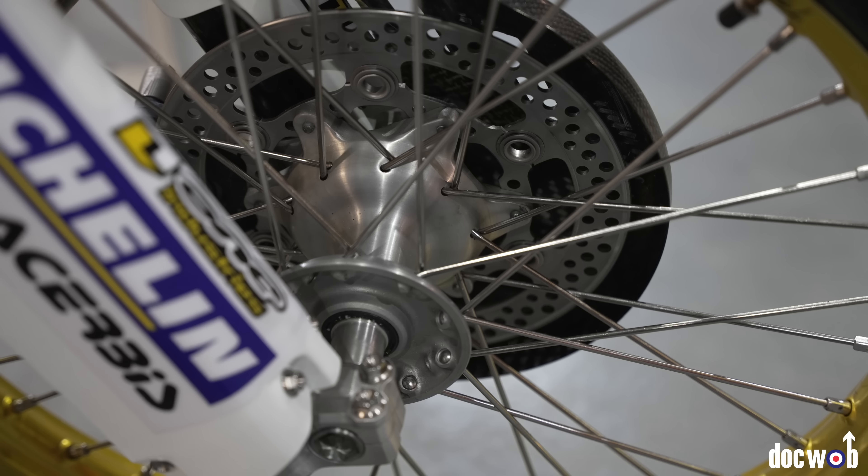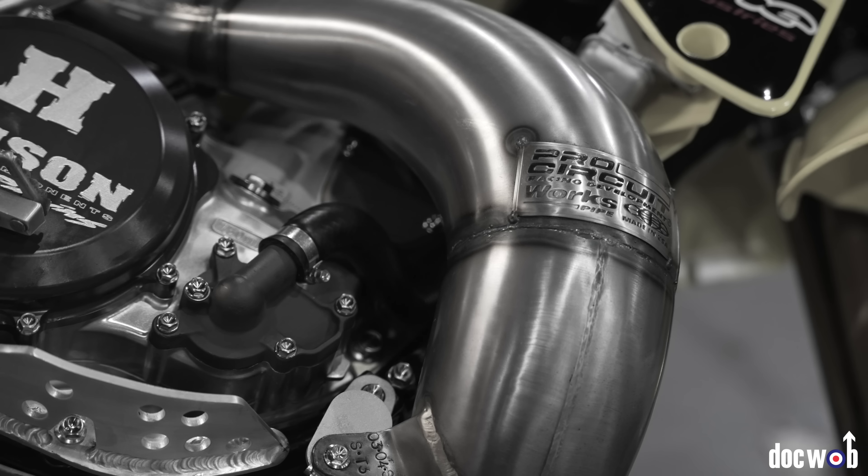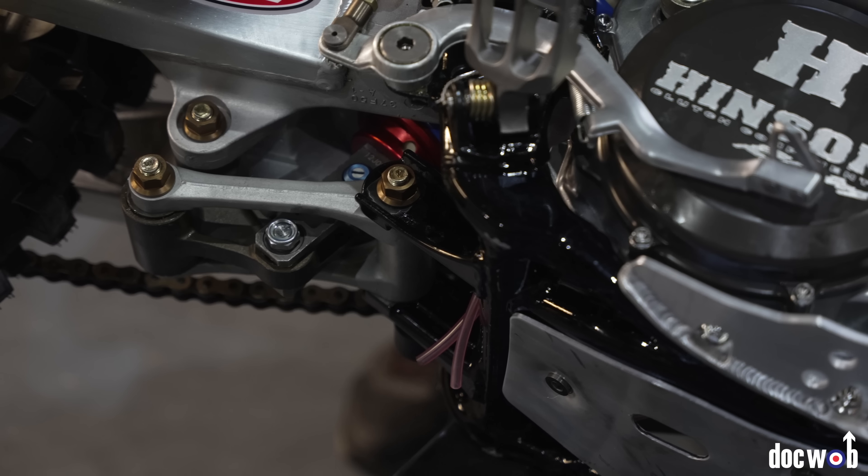So this is the factory frame with factory steering stops. Apparently RC in the early days used to smash the standard steering stops off through the whoops. So what they did is they moved the stops down the lower frame - because AMA production rules mean you can't remove anything from the frame, but you can add to it. So they machined some stops on there; we made a new bottom triple clamp with the steering stop, which actually five years later they incorporated into the RMZ, but this was early days. There's no stop on the front of the frame, it's now down the downtube - just means you ain't going to break it. You see this little sticker? That's Olympic Powder Coating in Santa Ana, California - they did all the factory Suzuki and Pro Circuit powder coat back in the day. It's just a little family-owned business, gone now or sold, but it just means it's a real thing.